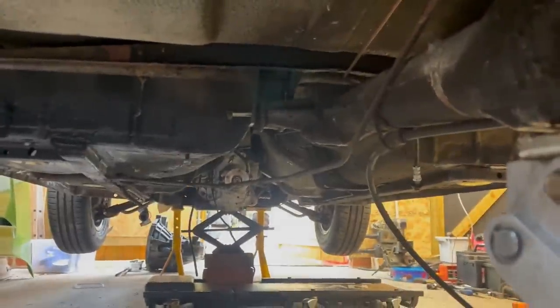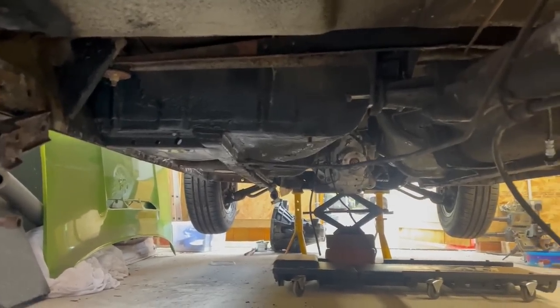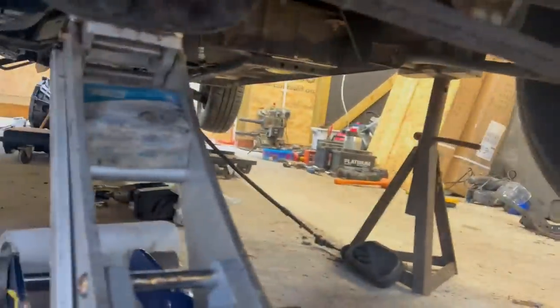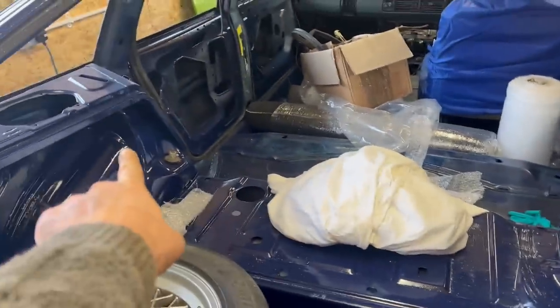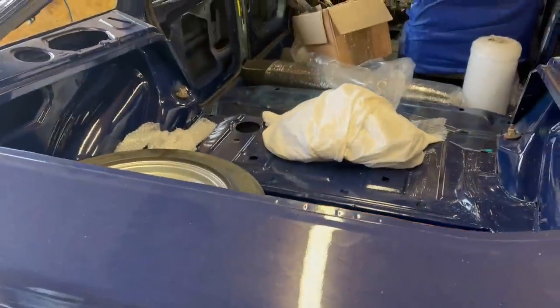One bolt up there, which goes between the torque tube extension and that chassis cross beam. So that's loosened. The Watts linkage undoes from the brackets here and here, just two 17 bolts. And then at the moment, the only thing holding it in is the rear dampers and that bolt which I've left hanging in the way. So I'm going to undo the dampers from the top. If I can get up, getting old. So yeah, just undo those, lower the jack down, undo that front bolt and wheel the axle out.